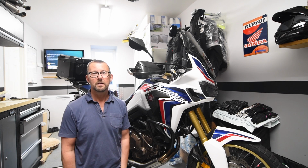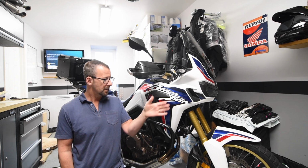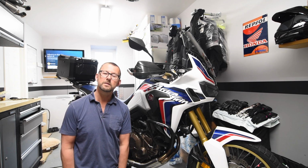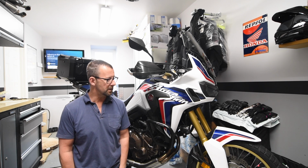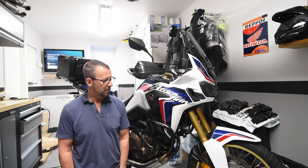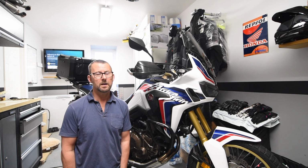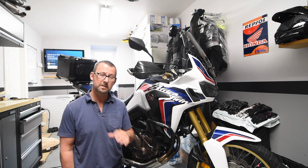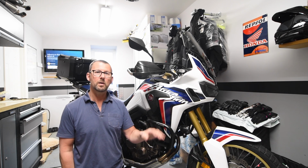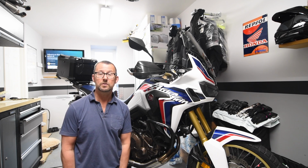I'm more than happy having done it. I've got no issues with any potential of the tyre because there's no tube in the front of the tyre now. No problems with the tyre possibly coming off the wheel itself, as it's 2 bar, 30 psi thereabouts. There's absolutely no way that tyre is going to come off, not for the road riding I'm doing, and other comments on the internet: guys that have done the same conversion before have hammered their bikes off-road, having lowered the pressures, and have not had any issues whatsoever.